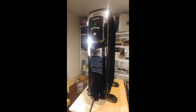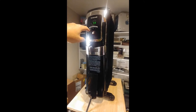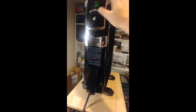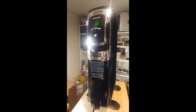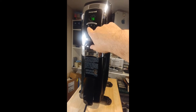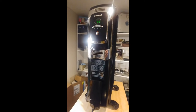Now that I've repaired the board, it does turn on. It's at the third — highest — level of power and thinks the room is 76 degrees. We can adjust the temperature; right now it's set to 70, so it shouldn't be on. If we turn it up to 80, we should hear the relay go — and we did — so it should be heating on its high setting. However, the control that adjusts the three levels of heating intensity seems to be stuck on the 1500-watt setting and won't go down to the medium level or the lower 600-watt level. So we fixed a lot of it, but one control is still not working. Let's take a look at why that might be.